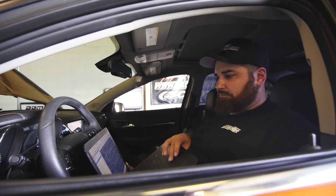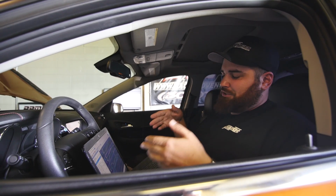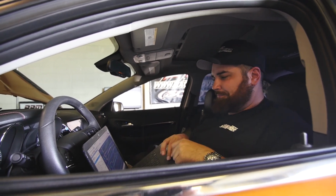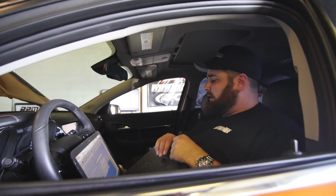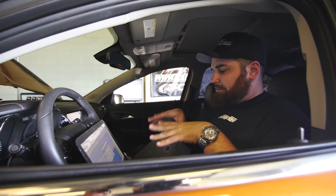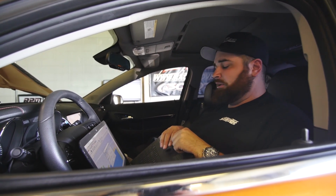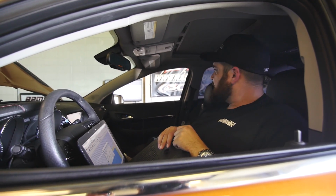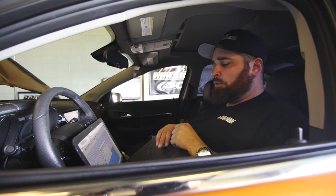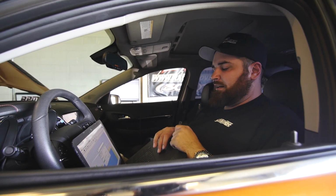Okay, so it's up boost. Yeah, slightly. It was 8. That shows 8.75. This shows 8. Yeah. Okay, it's the same. So it's up slightly in boost. We didn't change the pulley. We didn't change any of that. No, and I still got some power left in this portion of it. I wouldn't be surprised if it makes another 20. It's pretty damn good. Or more, maybe. I think if I rev this thing higher, it might make more.